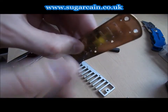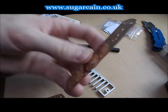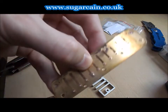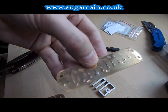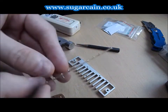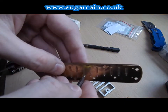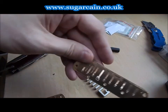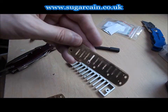Stick it in, line it up — there's my trusty screwdriver. Give it a few turns. I'll cut the tail end off after I've put the bolt on the top. When installing this, I always press it down into the slot so it stays — otherwise you'll be chasing it around. You want to go finger-tight — don't go too tight because you will bend the reed. So just no tighter than that — it was just biting, just past the biting point into its torque, and that's all it needs.